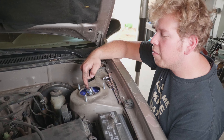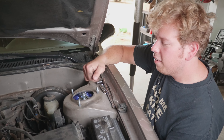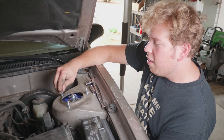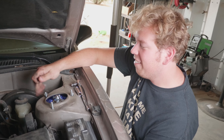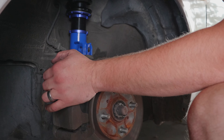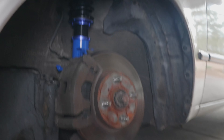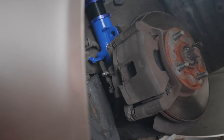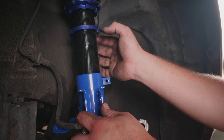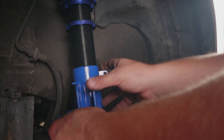If you do have camber plates, make sure your adjustment is in the meaningful direction — make sure it's towards the inside of the car, unless you also have caster adjustment. I will say, ideally you'd want these to be Acme threads because they can handle loading a lot better, but this is a $300 coilover. Acme threads are a thread standard where they're square instead of pointy threads.